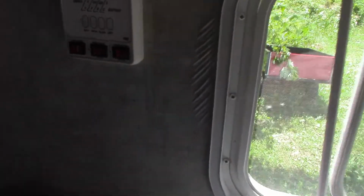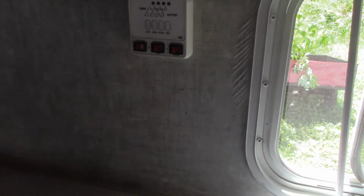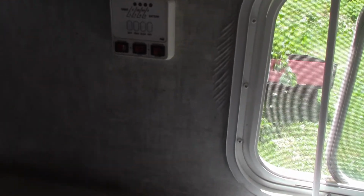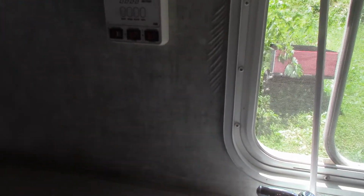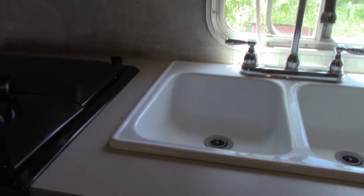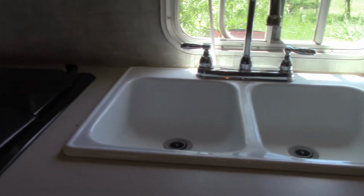You can leave the water pump on, but just a word of warning, I think we often find that the water pumps will lose pressure a little bit and will kick on and reprime every hour or two, which is kind of a pain while you're sleeping. So you may want to turn it off at night and turn it back on the next morning. Again, if you're hooked up to city water, you don't need your pump. You'll probably often go whole seasons without your pump.